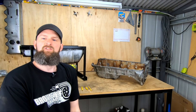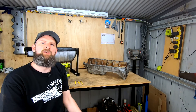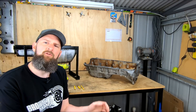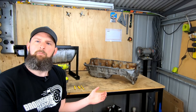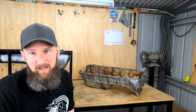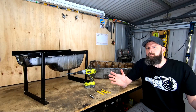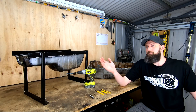These cast alloy sumps will be thicker but the material makes it more difficult and a little more specialized to weld. That extra thickness should make it a pretty good candidate to drill and tap - just be mindful that the material is a bit softer than steel and more prone to stripping threads if you over-torque your fittings. And I shouldn't have to say this but it is the internet after all - don't even think about the punch method with this one unless you want to be picking up chunks off the floor.